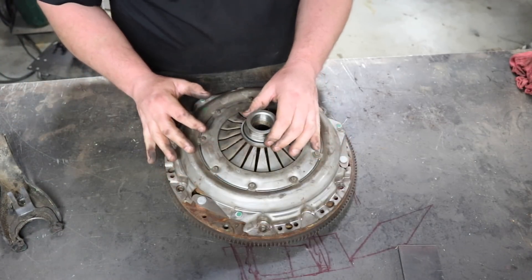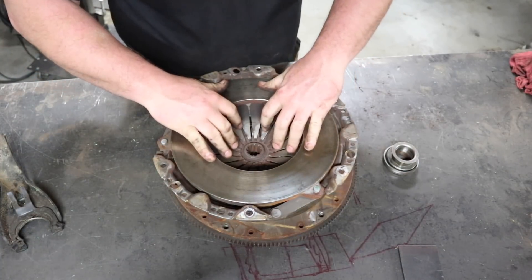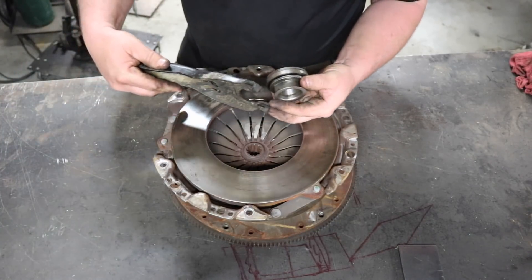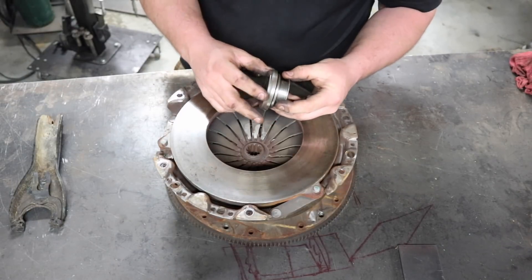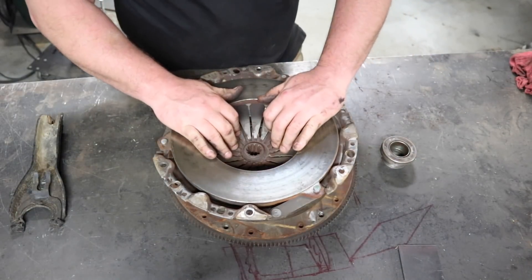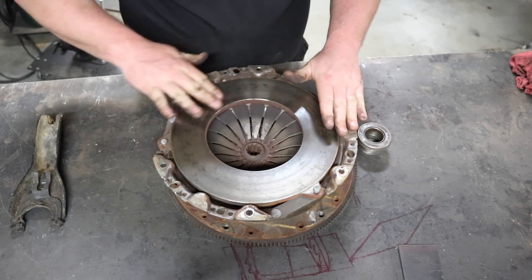This pushes here and these spring fingers right here get pushed down, and in the process of those getting pushed down it flips this big heavy pressure plate up. So when this gets pushed down, these fingers move towards the center — that's where this throwout bearing pushes. Keep in mind, this is a bearing — it spins — because it's hooked to the transmission it's stationary on the outside, but the inner race spins. So when you have your clutch in and you're revving your engine, this is spinning really fast, taking all the brunt of the load, sitting on these fingers. As these fingers move up, this big plate — like a cantilever — lowers.